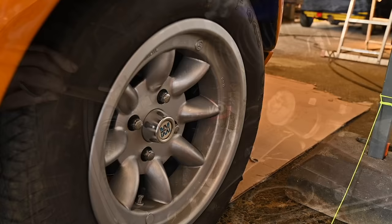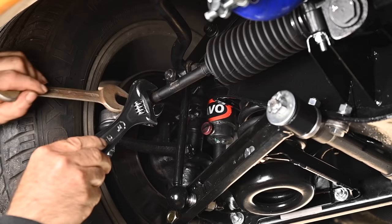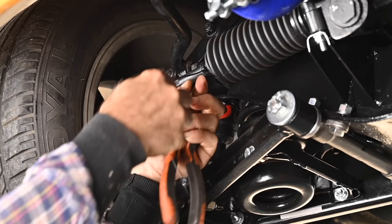Once the alignment is done, tighten the counter-nut using two spanners and lock it into place, then secure the gaiter and put a new tie wrap on. Now lower the car and take a test spin. Drive in a straight line and feel what the car does. If it holds the straight line, alignment is good. If it pulls to the right, you have too much toe in on the left or not enough on the right. If it pulls left, it's the opposite. Correct the appropriate side — it's always the opposite side to where it pulls.